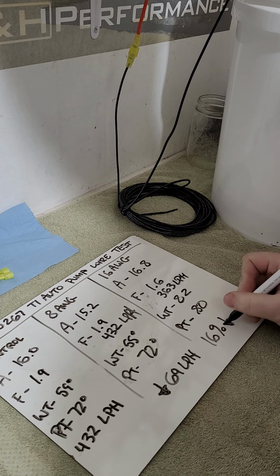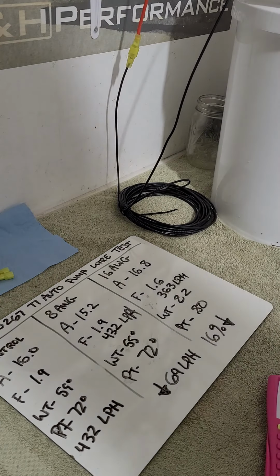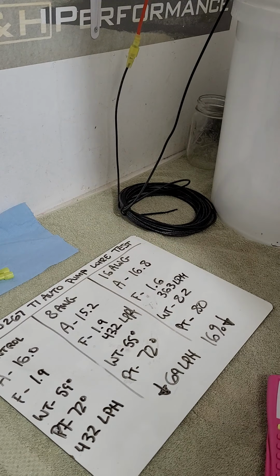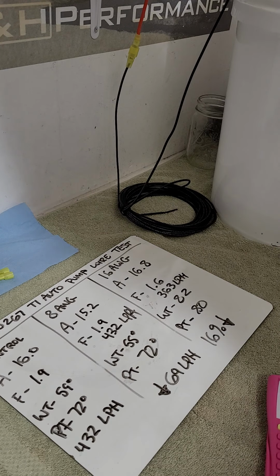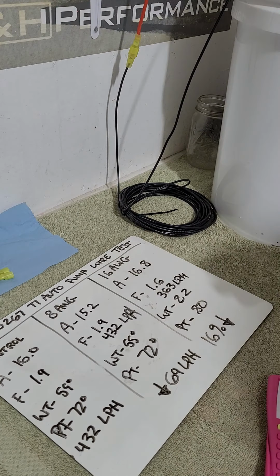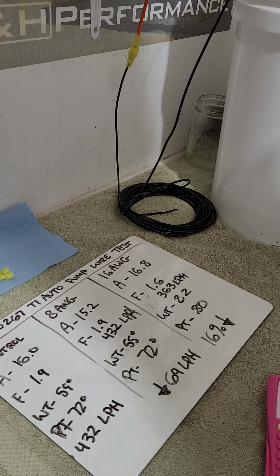That is substantial. So I actually had someone message me last night. They saw my PPRV delete, and he's like, "Hey, I want to get it for my car." I was like, "What are you doing?" He's like, "Well, he had an 11 GT500, I think, which for some reason the 11 and 12s only have a single 12 gauge wire running back there instead of a dual 12 gauge like the earlier GT500s. So he had a pump die. And that's kind of a trend we're seeing. The pump wore out pretty quick."